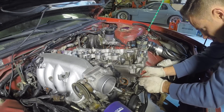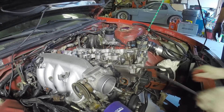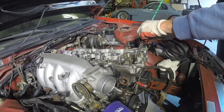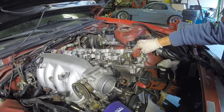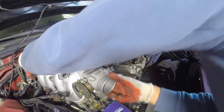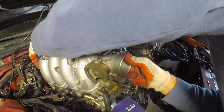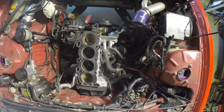I threw on a few zip ties through the links and then slid a screwdriver in so it would keep the chain from falling into the front case. I've seen guys muscle the cylinder head off solo mission, but I wasn't about to take a chance, so Dave jumped in and we lifted the head off with ease — and underneath was quite the surprise, and not in a good way.